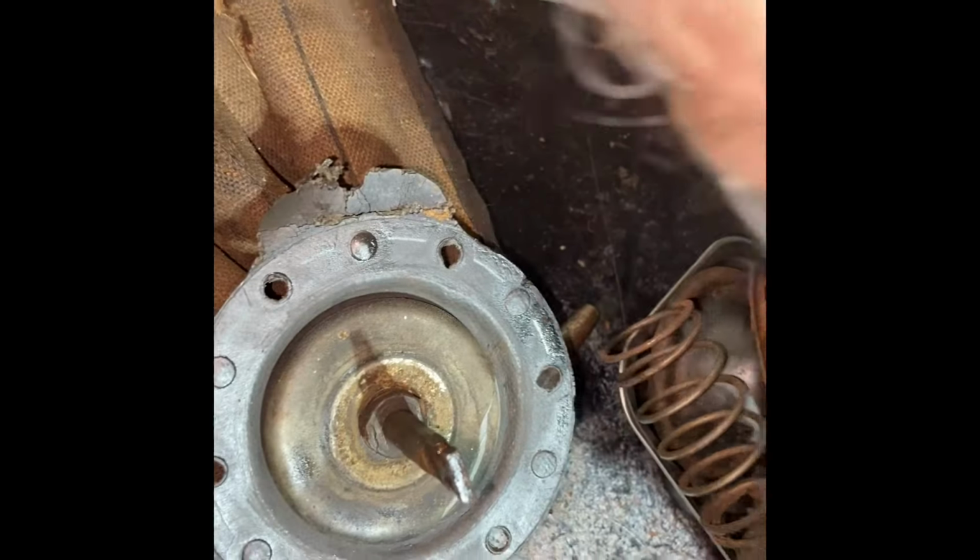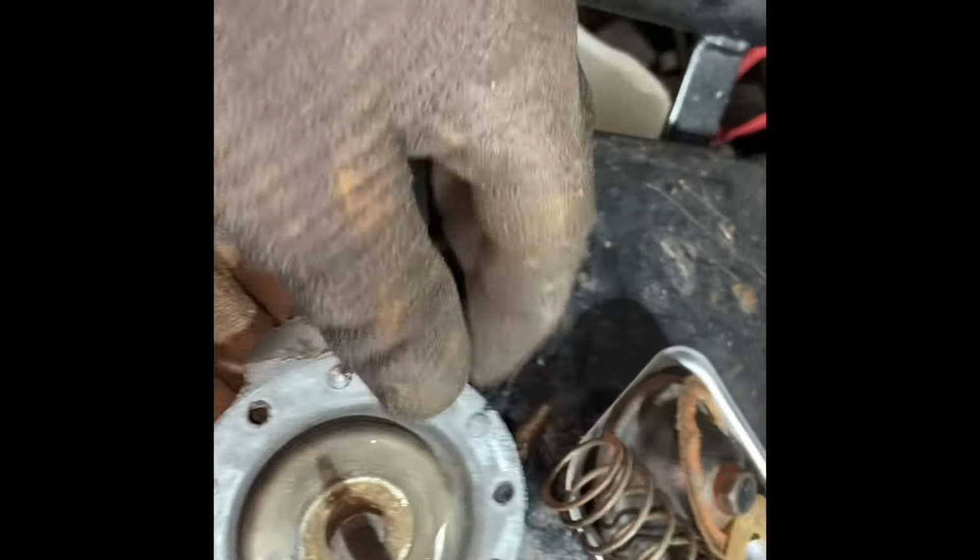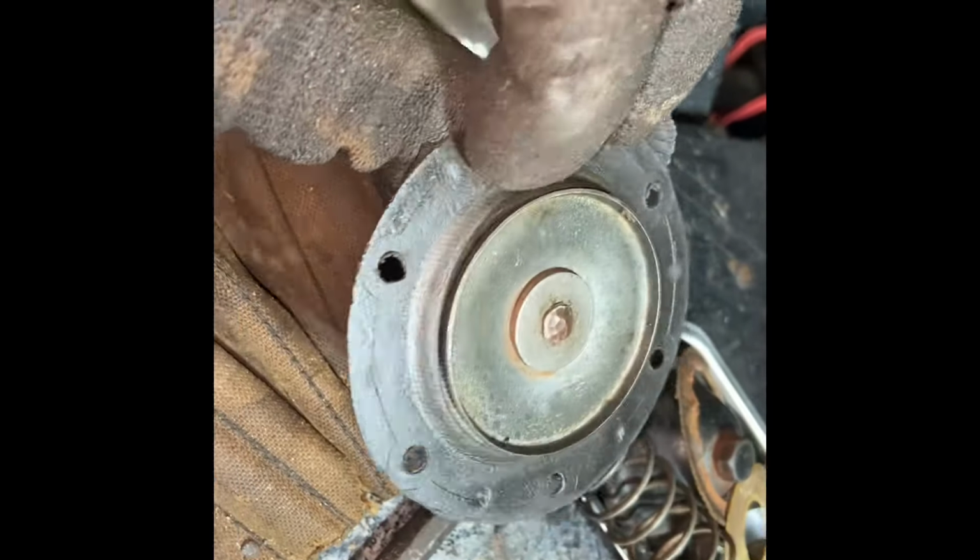That was the other thing. I did take that fuel pump off. Let me just show you that for a second. The fuel pump was round here, remember? That's where it was. And it was absolutely solid, full of debris and such like, right? I took it all apart. Here's the component parts of it. This little screen had a big dirt dauber on it. That's the diaphragm, which looks actually still pretty pliable. I can move that with my finger.